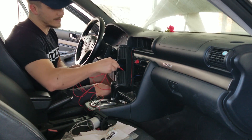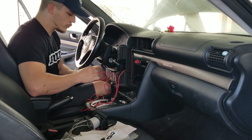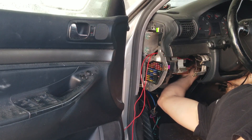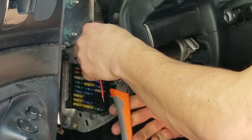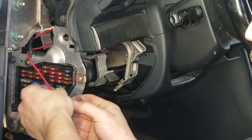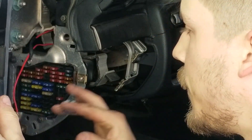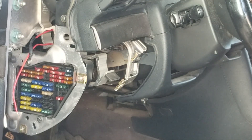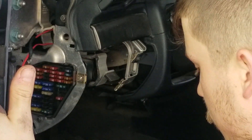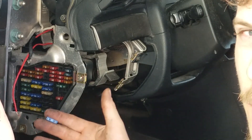I had to re-feed these wires because I didn't feed them through the plastic bezel. I'm gonna braid them together and try again. I pulled this 15-amp fuse for the cigarette lighter — that's what I'm gonna try first. I'm just gonna wrap the wire around it and plug it back in to see if that works. If not, I'm gonna connect it to my radio fuse, the 20-amp. I want to get it to come on with the lights, but I don't want to mess with the headlight switch because those switches tend to go bad. So I'm gonna plug into the fuse box — there are cleaner ways to do it, but this works.